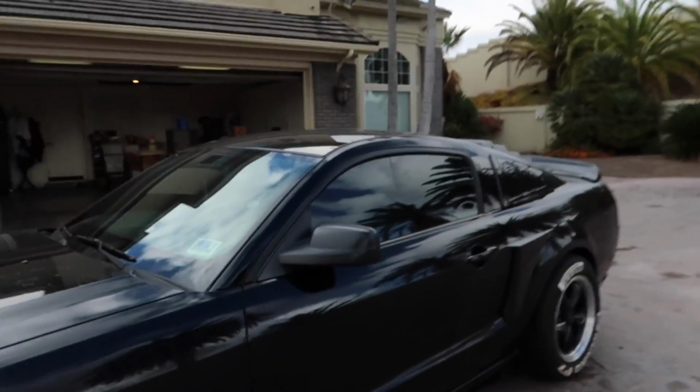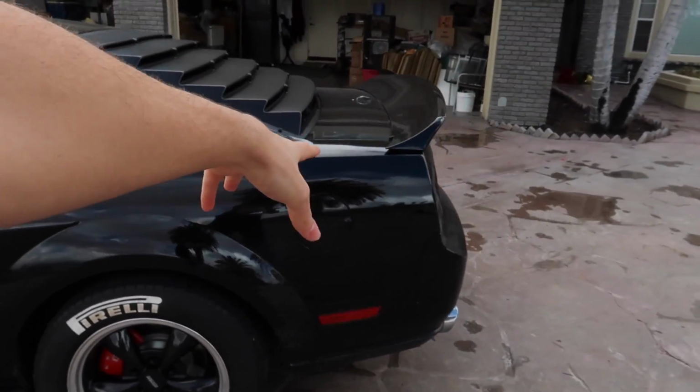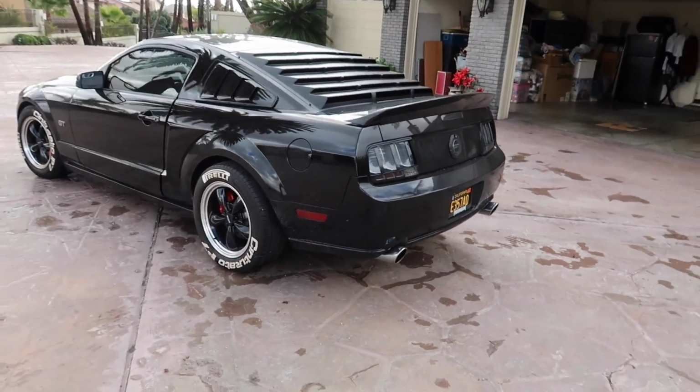But I know if you have other internals, you can get up to internals and long tube headers, you can get up to 50 horsepower, with long tube headers to come summer of 2018, hopefully, we'll see. And so that's basically it. And also the higher RPMs that you could possibly go with these. I know that the rev limiter is 6,800 with these camshafts.